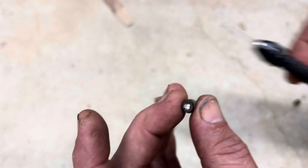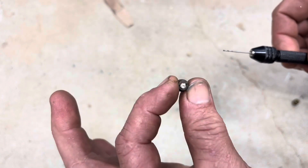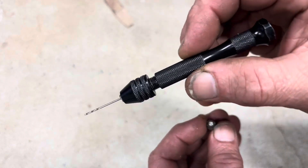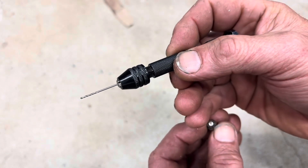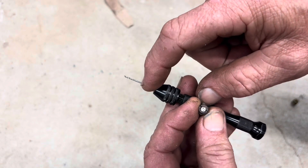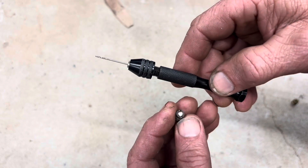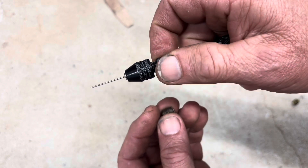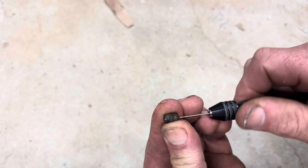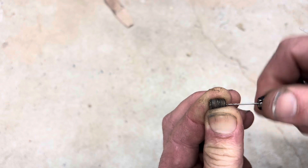And now I'm going to drill my 0.95 millimetre hole through the centre of that, and that will be a 0.95 jet. I use number drills or I've got a mini set as well that is metric. It's always important to — I always check my drill bits with a digital vernier caliper just to make sure that I'm drilling the right size. So this one's basically just a hand chuck, mini chuck. Pretty old school, but it's only drilling solder, so it's not overly hard.